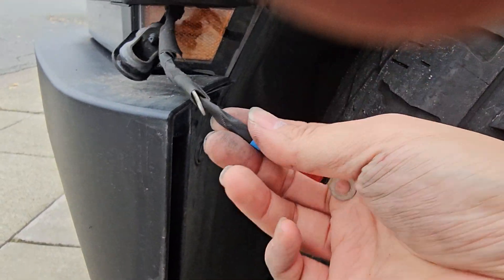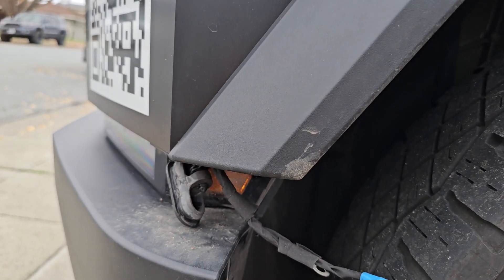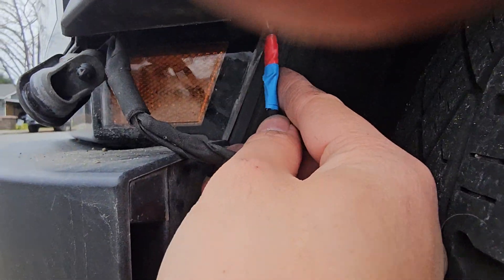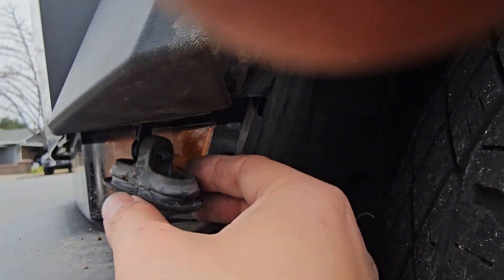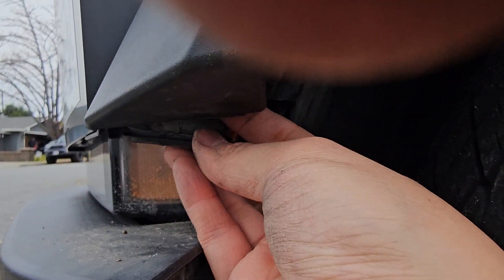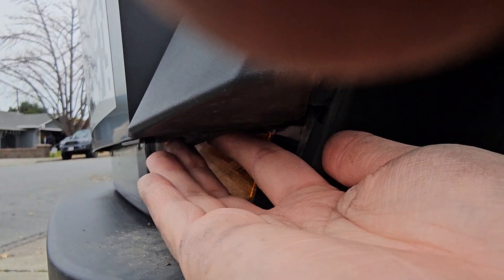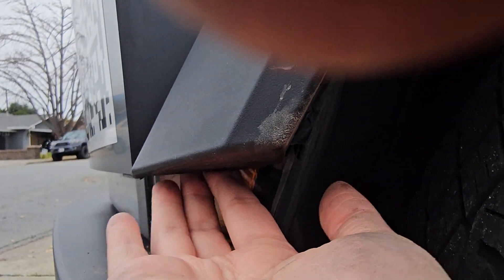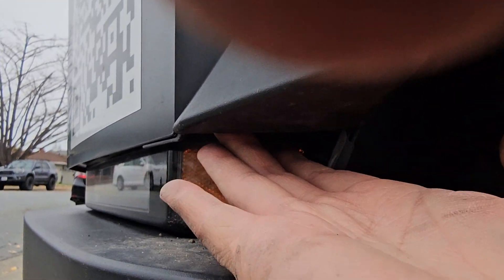Here's the red and here's the black. You basically just jump this and it will pop open — the latch will unlatch and it will allow you to open up the frunk. That's if the low voltage battery system is dead. It's not actually a 12-volt system — it's a 48-volt system. Then you want to put this cover back, because you don't want to leave it hanging out there. Find the hole and shove it all back up in there. You might have to pull it in towards the center as you're pushing it up, because you've got to squeeze that part to make it go in.